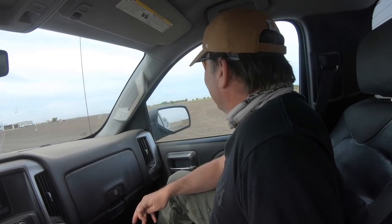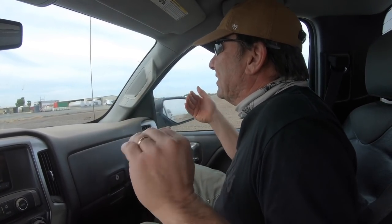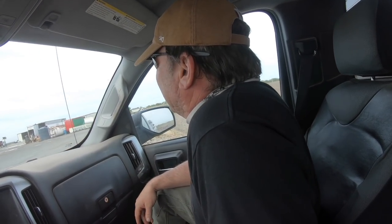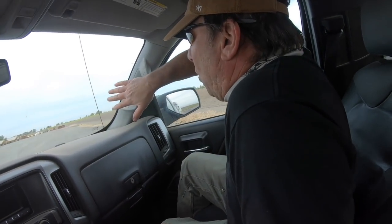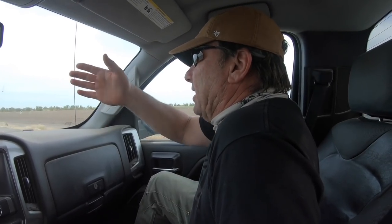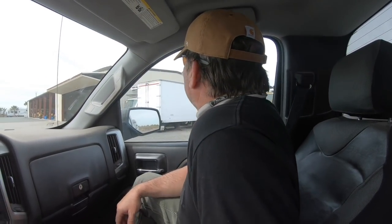Wow, dude, yanking and banking, turning and burning. That's what these guys are doing. The hustle is on. Aileron, and an aileron is that thing when you see in commercial pilots, that thing that kind of folds down on wings? The aileron is the lateral control of the aircraft via the wings, right? Yeah, okay. Up there on the wings. Not the flaps, but the ailerons. Yeah, that's the roll control. That's what's allowing you to do these bank turns all the time. And the spades are helping you relieve the strain of doing that repetitive over and over and over. It makes the controls nice and light.